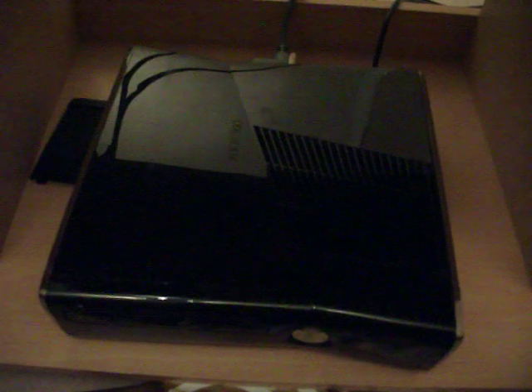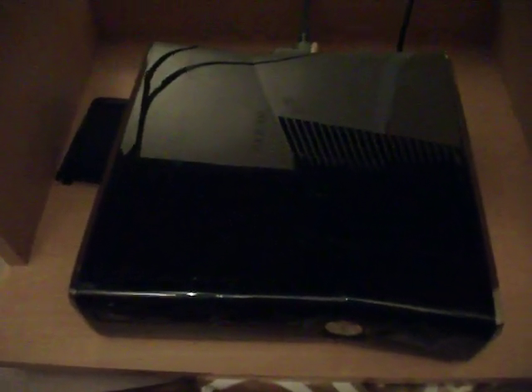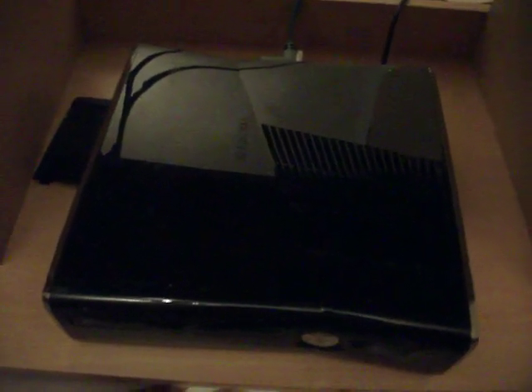This Xbox does get a lot hotter. The hard drive is internal, but that doesn't mean you can't get it out — people mistake that and think it's stuck inside, but you can remove it. You get this part of the fan that goes down there, you pull this back, and you pull out the drive, which is here. It is 250GB. To get the hard drive out, you pull on the wire, which is actually quite elasticated, so you can pull that out.